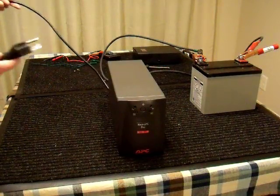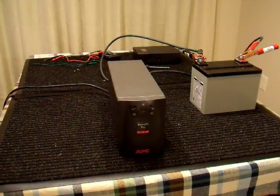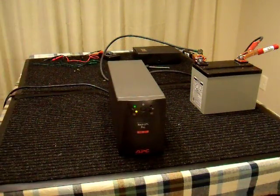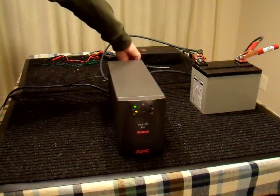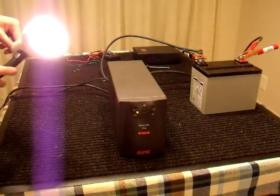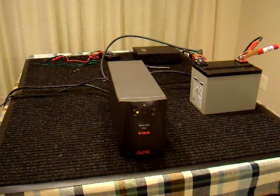The UPS is not plugged in. Usually on these units you can turn them on by holding in the power button and releasing it immediately after it starts up. There we go — it runs off the battery. Just to test it out a little bit, I have this 60-watt light bulb and I'm just going to try plugging that in to make sure it can at least power a small load. Success! It beeps every once in a while to let me know there's no line power. I'll have to fix that because it's pretty annoying.